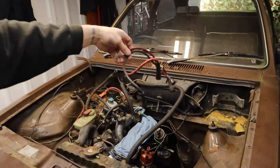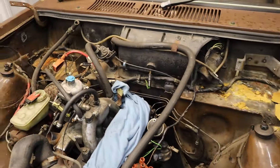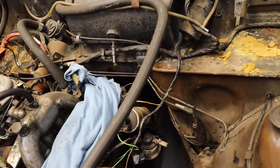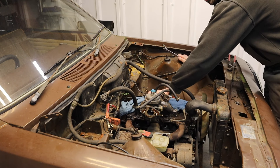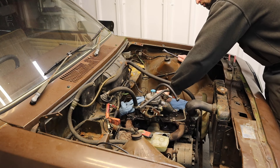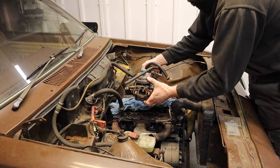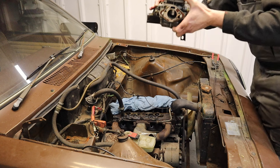They actually keep their shape - they're so old. So they're off. We've covered this off, we've taken the servo pipe off. So now we're going to take the inlet off and take the fuel pump off. To be honest, these bolts are not even tight at all - they're literally barely finger tight. I'm glad that we've taken this off, because that is a bit concerning - someone has messed with this.